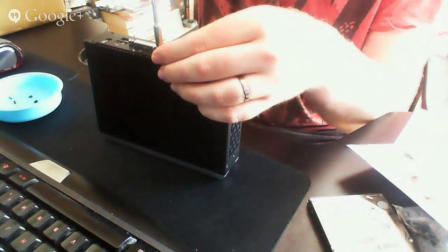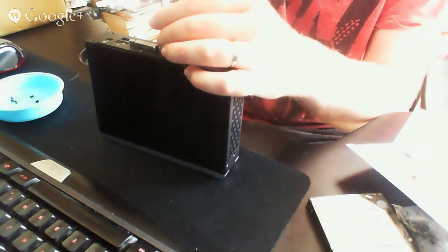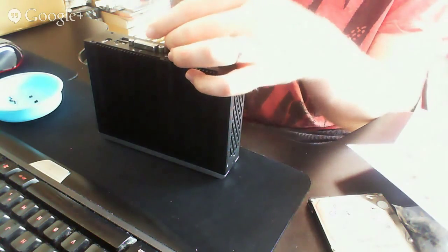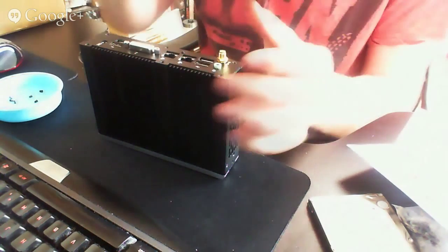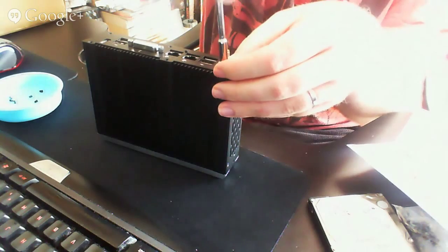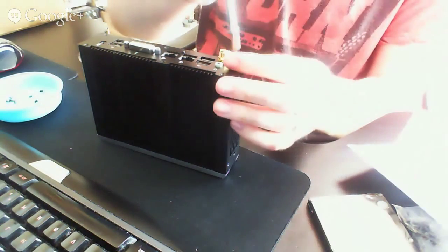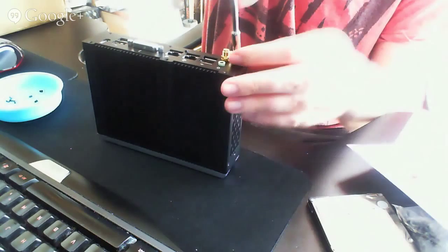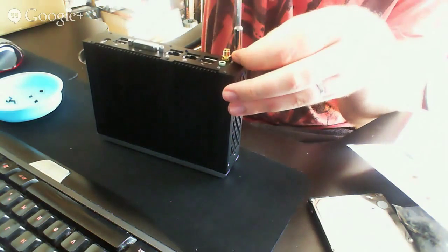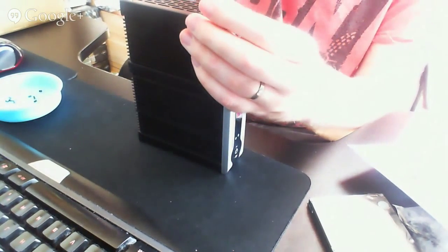So, once I've gotten all the screws out, I will hold it up to the camera to give you guys a much better look at the internals. It takes laptop RAM, a mini PCIe card. With the mini PCIe card, you can either put in a wireless card, which this model will have in it, but it also doubles up as an mSATA port. So if you get the edition that doesn't have wireless, you can really go small and quiet with an mSATA SSD. If I had a spare SSD lying around, which I don't, I would put an SSD in this to make it entirely silent.